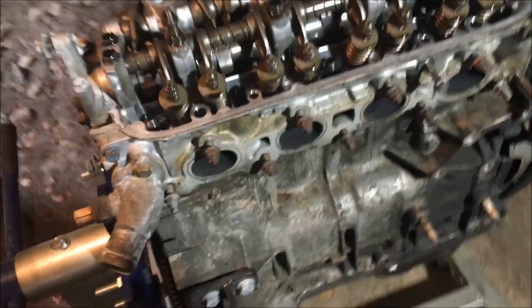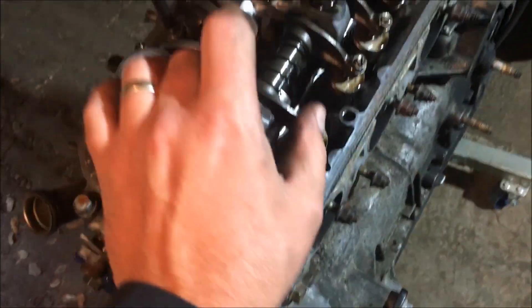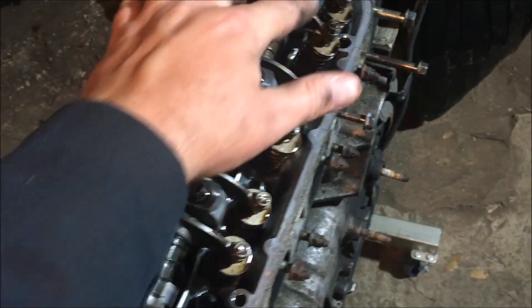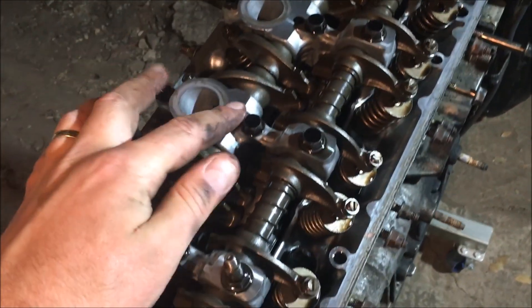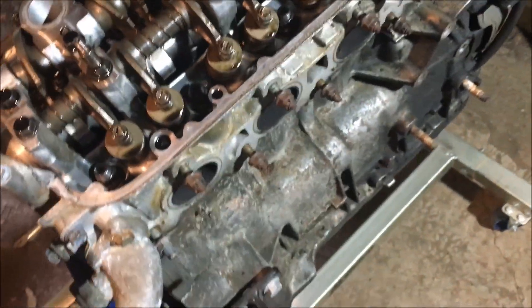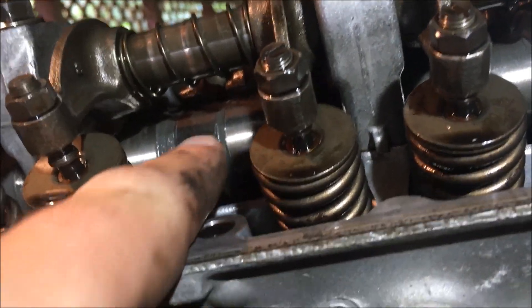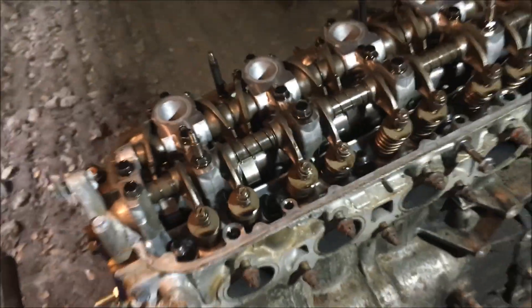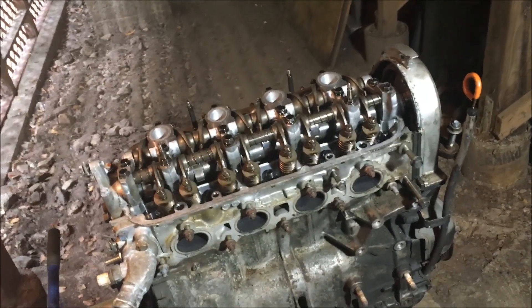So now I got the valve cover off. I'm looking in the head and the valve train, and everything seems fine. I know that I needed another valve adjustment — things were a little on the loose side, a little noisy for my taste. I know it's better to have noise than to have no noise because everything's too tight, but I'm also looking — there's some scrape in there. That's not necessarily good, so that's not a good sign, but it's definitely not what was causing the noise. So next I'm going to take the head off after removing the timing components.